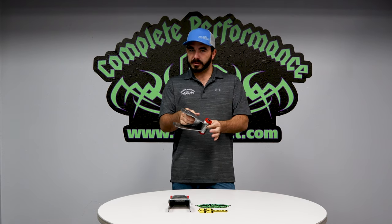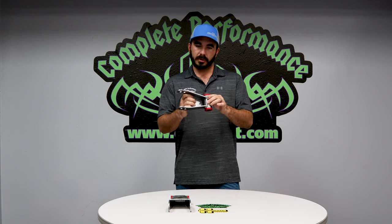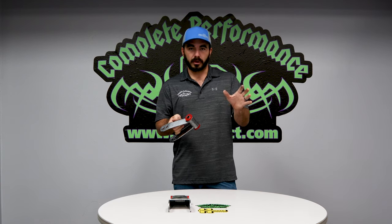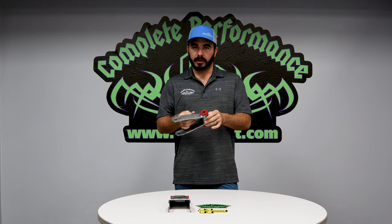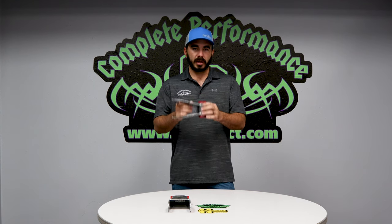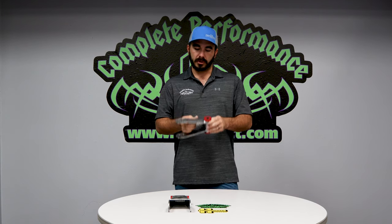Basically, do the rest of the steps in reverse. Once you put the bolts back in, put the weight back on the truck, make sure they're good and tight. Take your transmission out of park, take your block out. Drive the truck. I always recommend this. Drive the truck 20, 30 miles, a little bit more sometimes, and then re-tighten this stuff. Make sure that it's still snug. Anytime you loosen a bolt up, there's a chance of it coming back loose. Just as a precaution, always double check your bolts. Make sure you've got everything tight, especially after a couple of miles of test drive.